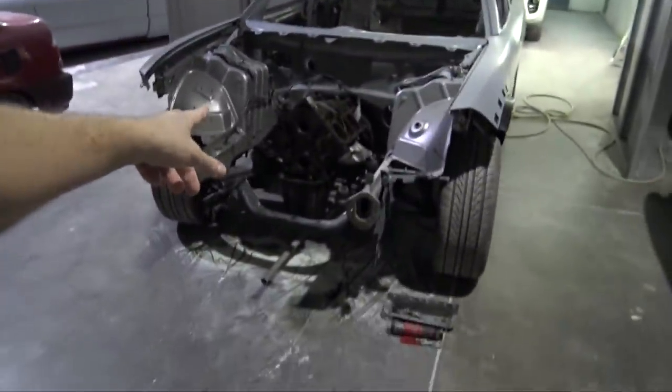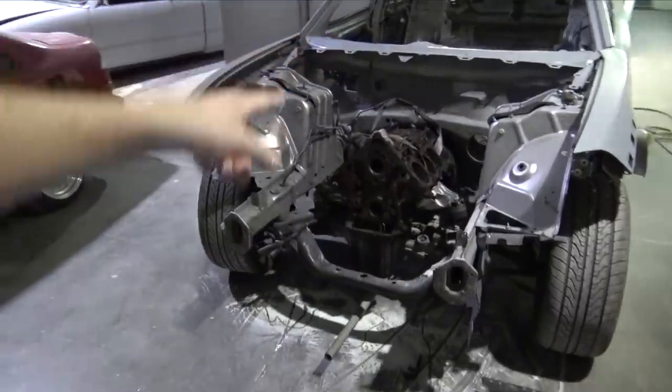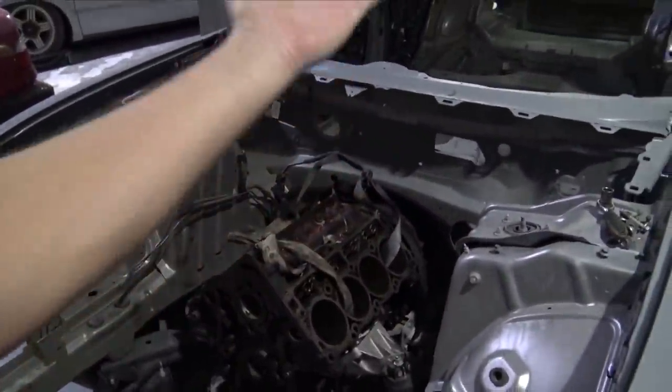But I'm glad that the engine block, tranny, transfer case is now in. One thing, I'm gonna have Jose from DIY Gang check his Trackhawk because I feel like I almost have my tranny and transfer case too high up in the tranny tunnel. So I was trying to use the factory Hellcat / Scat Pack tranny mount because it bolts to the transfer case. Everything seemed like it worked, but it seems like it's pushing it up too high in the tranny tunnel. I feel like it's way too high.